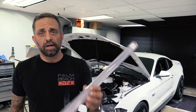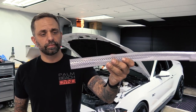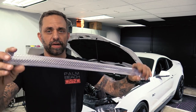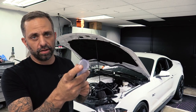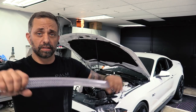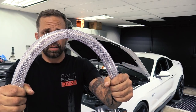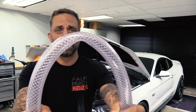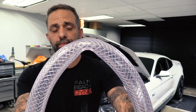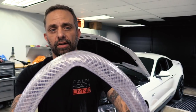The other common thing I've seen used is this right here — I call it Home Depot hose. It's a reinforced rubber-plastic setup, and it works pretty good, but here's what happens. Most of the time we want a one-inch ID hose, so routing can be challenging — you're going to have to bend corners. This is a brand new hose that hasn't seen any heat yet. When I bend it around a turn, you can see it kinks in the middle — that's not going to flow very well. Intercooler pumps don't really work well under pressure, so you don't want any restriction or pressure buildup.